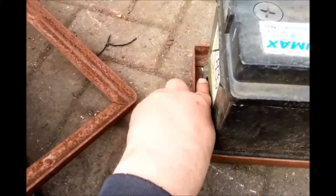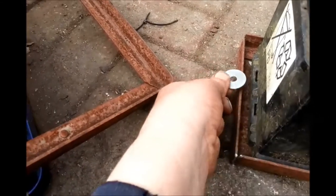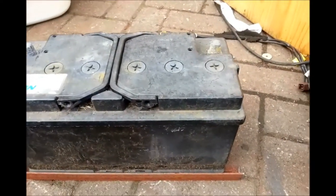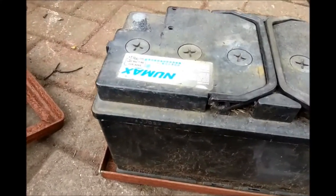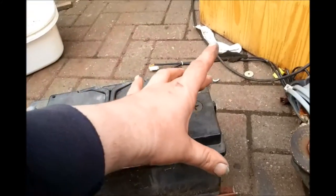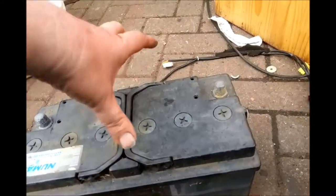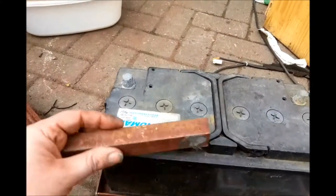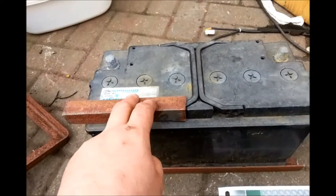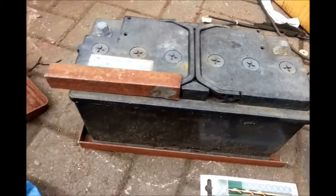Put a nut over the top here; at the bottom there's this piece made to fasten it down, and I've got some big washers — I should be able to put the bolt through there and it can pivot and pull down against the battery. That should hold it fairly secure. The only issue I can see is with the battery swaying side to side if it's on four poles bolted through the floor — if there's a gap between the top of the battery and the floor it's going to be able to move. I can bolt that through and tighten it up against the bottom of the van, with a cover for the terminals.